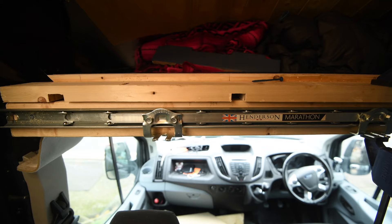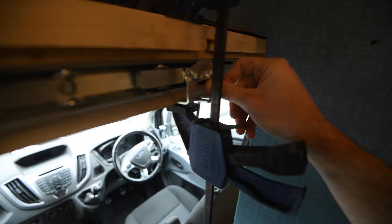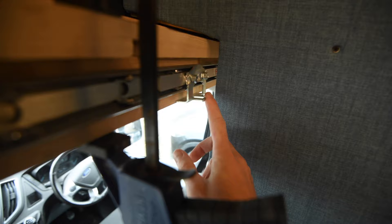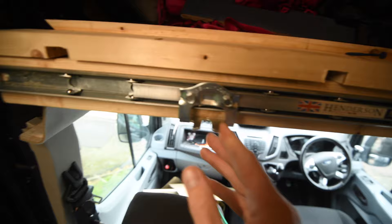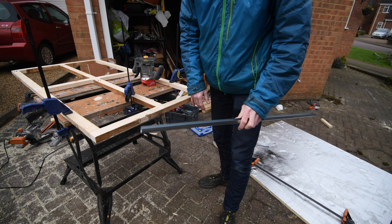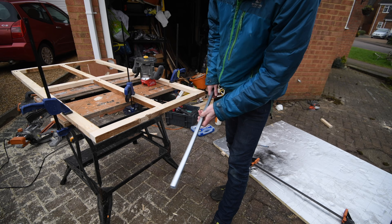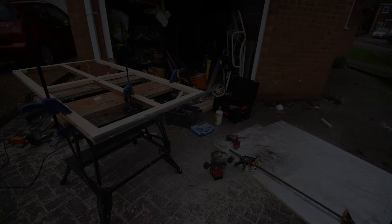The rail is on a temporary mount and that's generally how it's going to work. The door hangs off these and we'll have a floor rail when it's mounted, but it's just figuring out the right distance back so that it clears this wall and the door would hang freely and clear the bottom of this seat. For the door to stay in line on the bottom it has a channel which needs to be routed out - it's a 16mm by 16mm rebate I need to do. I don't have a 16mm bit; my biggest one is 12mm, so I'm going to do a few passes and figure out the rest of the way to do the rebate.